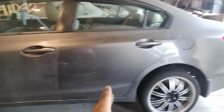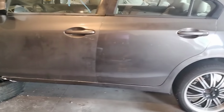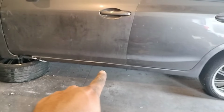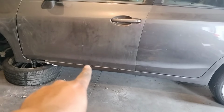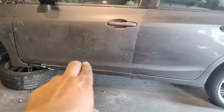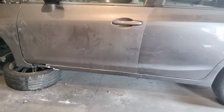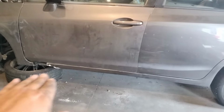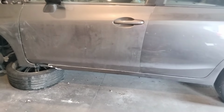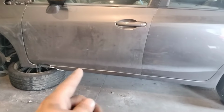Opens and closes. And also this right here is fixed. Lines up really well. And all we are not lining up is down there. There's a piece of bondo that goes from that point to this point, and it's pushing the door up a little, so we need to shave that off so the door can freely open and close. So yeah, we're gonna have to sand a lot in that area right there, and we're gonna cut about right there, so that's way past our limit.